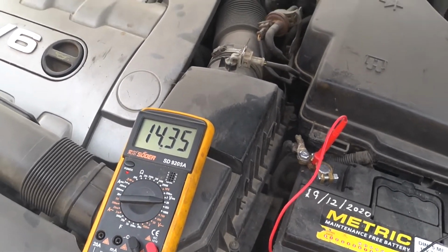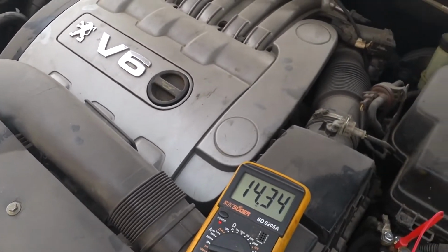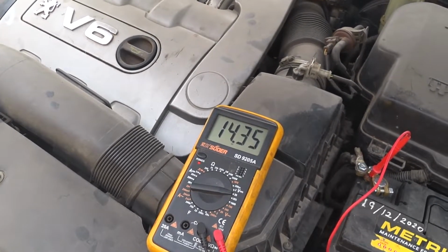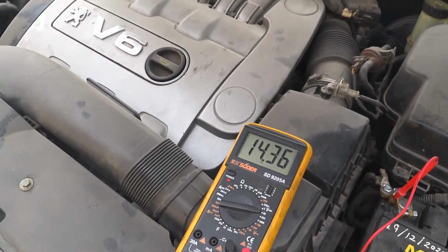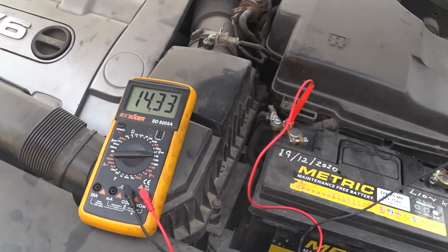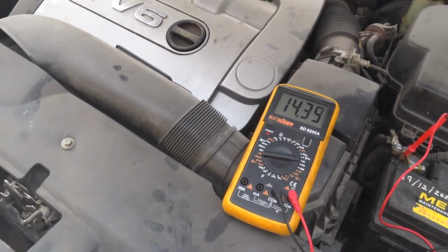At least I pointed out how I did mine without removing the radiator, which most people prefer to remove, and some even remove the power steering pump. I don't want to go that route. Maybe if I hadn't gone to that compressor side, the AC gas probably would have leaked out completely, but you can see it was already swollen. It's just a question of time and the gas would eventually all go out from that particular spot. So it was an opportunity to see that problem, which I will fix hopefully in a day or two. I won't take it to an AC technician, they will just replace it, put in another gas, that's all.